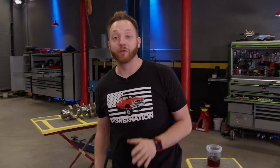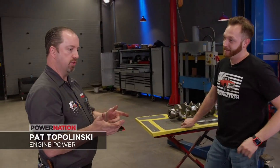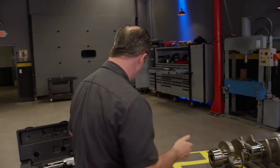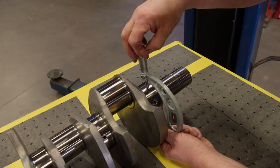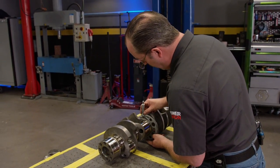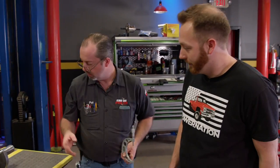Checking bearing clearance is a very important step, but it requires tools that measure very precisely — down to ten thousandths of an inch. I don't have those tools, so we're going to borrow Pat's. First thing we do is measure the crank to make sure we set our gauge right so we can measure that hole properly. We get our mic out and mic a journal — very carefully measure and take it around each journal. If it feels the same, they're the same size. When we're micing it for size, we're not micing it for roundness because it's a new crank. This is a very accurate crankshaft — I can already tell by the first three I've done.